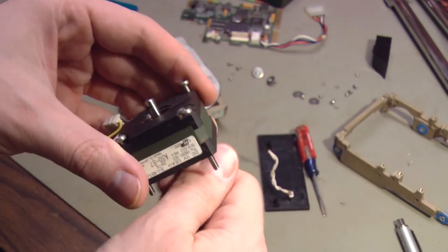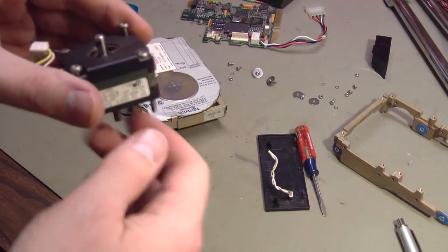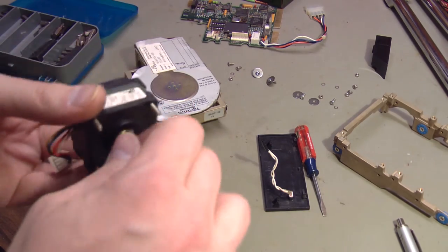I felt bad on others that are working properly. Still, all in all, I've only put about 6 or 7 drops on this bearing up here. I don't feel too bad about that. You can do a lot of damage by over-oiling a motor. I'm going to leave it right there.